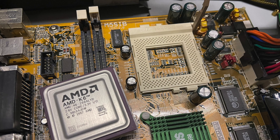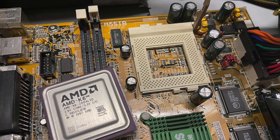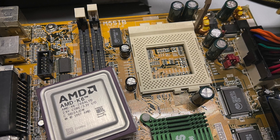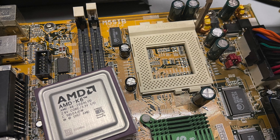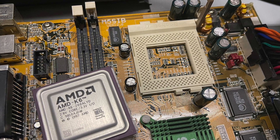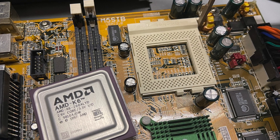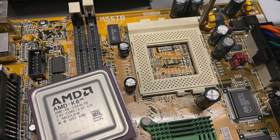The Intel Pentium 233 is an interesting one — the floating point performance is obviously decent. But overall it doesn't keep up with a lot of the other chips in other benchmarks, especially the higher-clocked ones like the K6-2 and the PR333. It sticks with the K6 and the MX chips but doesn't really step up to SuperSocket 7-level performance for a lot of benchmarks. The Pentium 133 did pretty well considering it is quite a lot slower — definitely not half the speed of the 233. That comes down to the cache being the same speed on the L2 and the front-side bus being the same, so you're not going to get huge improvements — you'll have a bottleneck somewhere.